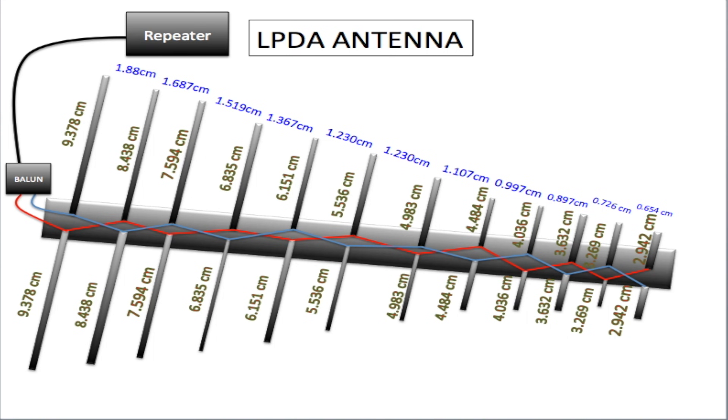For those interested in boosting cell phone signal, I'm also using a repeater. The signal comes in from the cell tower to your antenna, goes to the repeater which boosts it and transmits it into your home. Signals from your phone back toward the tower also go through the repeater to the antenna. This gives you a stronger signal both from the tower to your phone and from your phone back to the tower.